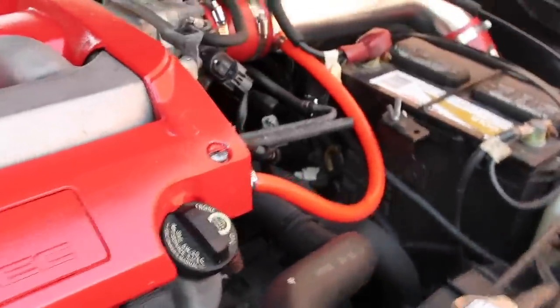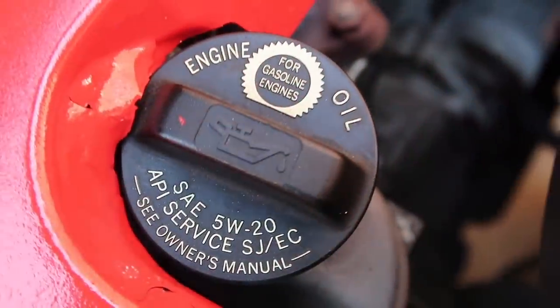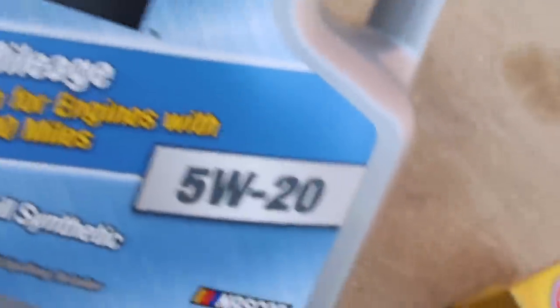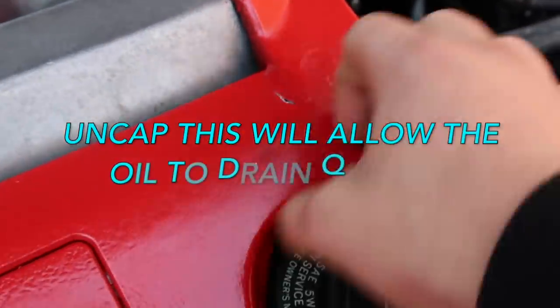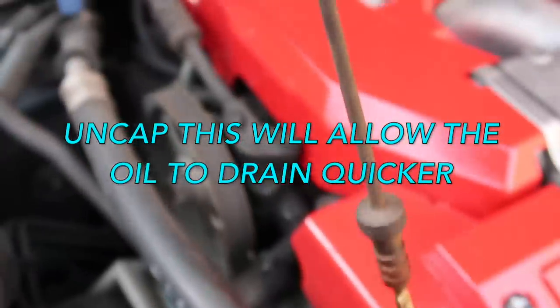Make sure you take out the right things — don't touch this, don't touch that. Where the engine is at, you go right here and look for the cap that says engine oil. It says 5W-20, so that's exactly what your car takes. Just pull out the dipstick — it's a stick with oil on it. Just have it up right there.